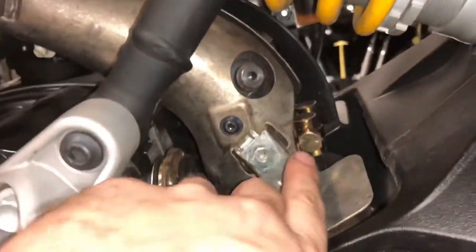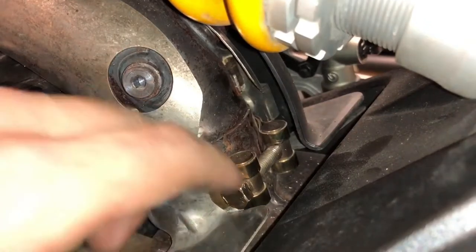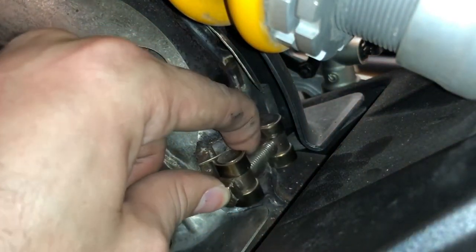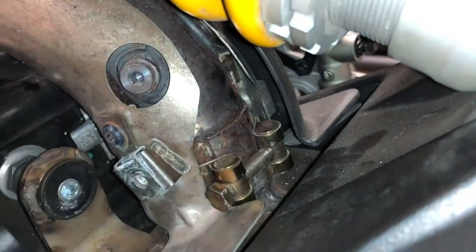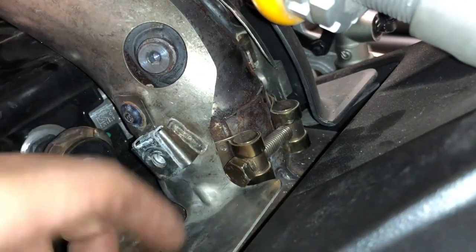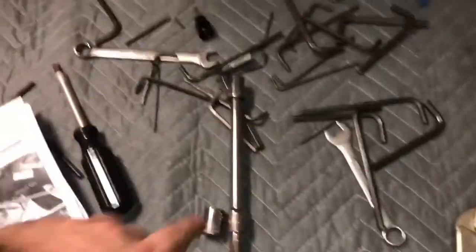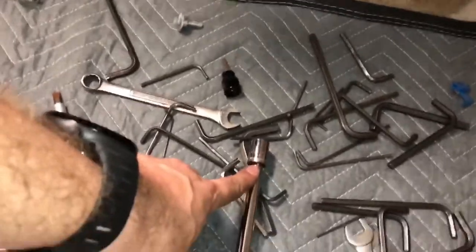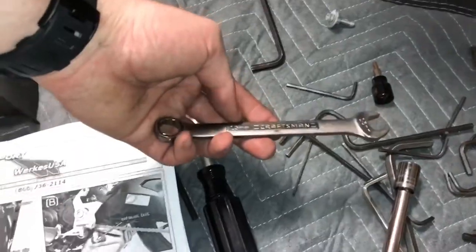The next thing you want to do is there's a little clamp right here — you're gonna want to loosen this clamp. I went ahead and loosened this exhaust clamp bolt back here. Once you get play in it, you know it's been loosened. This one was kind of hard to get to — the person that tightened it kept it real close, so when you retighten it make sure you keep yourself off it a bit. I actually ended up having to use a flex extension — so far I'm doing everything the hard way.